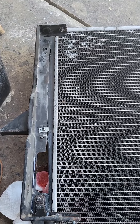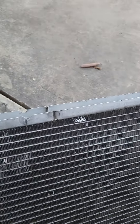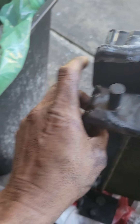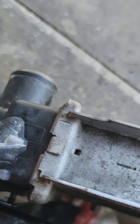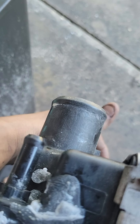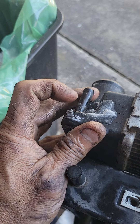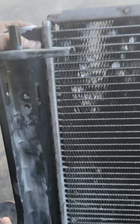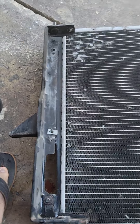That's very stupid how Ford designed this. The reason I'm changing my radiator is because the top of it right here — this plastic — it cracked, so coolant was seeping out of it. Most of the time when you have a coolant leak from the radiator, it's usually going to be from the plastic because it gets hot and then it just cracks. I tried to super glue it for a quick fix, but it only stopped it a little bit, so I just went ahead and ordered one on eBay for like 88 bucks. I'm going to go ahead and put a new one on.